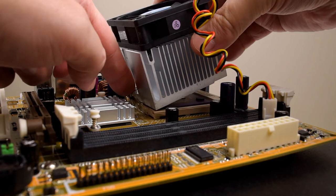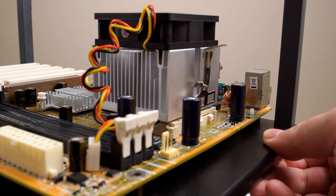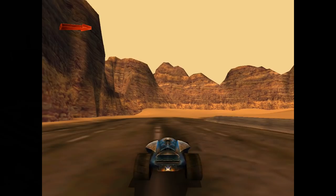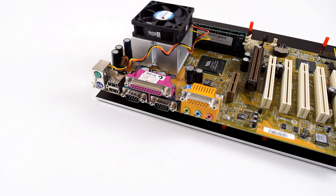I've spent quite a bit of time with this system — check out my recent build video linked in the description. I also did a video on power supply issues for Socket A, which is definitely worth watching if you're planning a Socket A build, as the choice of power supply is quite important. Based on that, I made some changes: the GeForce 3 Ti 500 turned out to be very power hungry, so I'm now using a Radeon 9600 XT, which draws around 20 watts less and also supports DirectX 9.